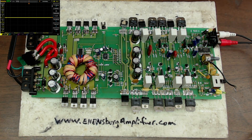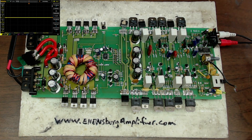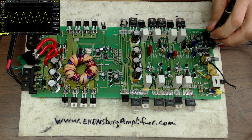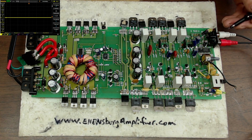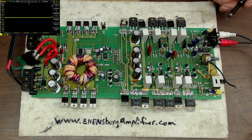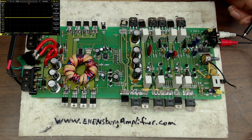In the previous video I stated I would adjust the input circuit to compensate for today's higher voltage head units, and that's exactly what I did. Right now I have a 2 volt signal going into the input of the amplifier. As you can see on the scope — 1.99 volts, close enough — so we'll call it a 2 volt input.